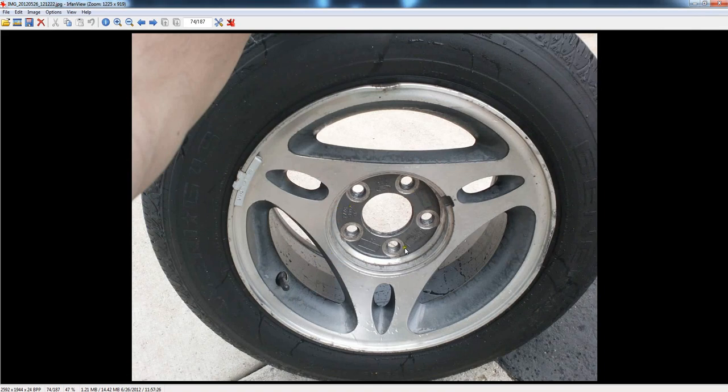I took the tire and washed it up. Duct tape works better than scotch tape or painter's tape because it won't stick very well to the rubber. But I noticed that if you've used a lot of tire shine stuff to make your tires look shiny and brand new, the duct tape doesn't stick too well to that either. So what I found is: just take duct tape and cover any of the weights on the rim so they can be removed later, and also duct tape your valve stem so that doesn't get sprayed.